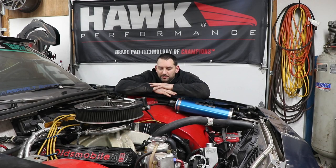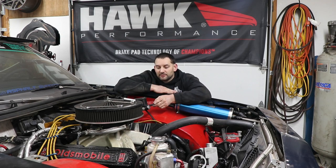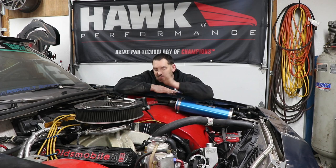As you saw from that short clip, the brake master cylinder moves around when I step on the brakes — and I'm not even standing on it like I normally would on track. The firewall is flexing and letting that movement happen. I've been wanting to fix this for a while but never had it as a priority, but now that we're in the offseason it feels like a good time to take care of this small but important thing that will help improve the car.